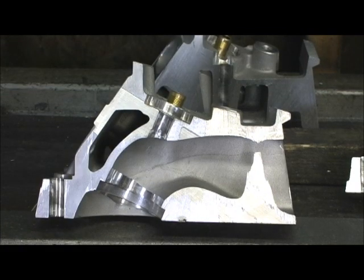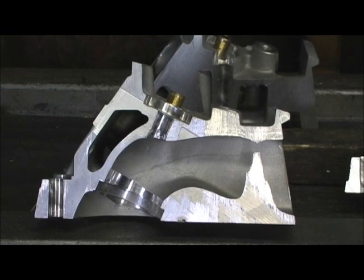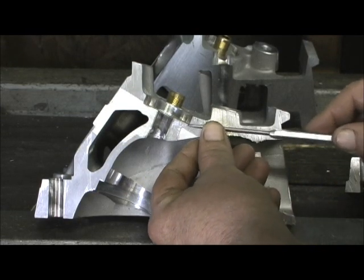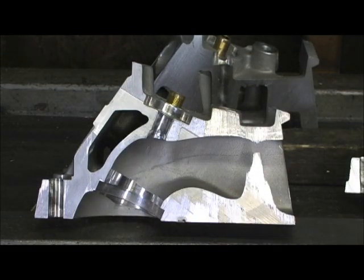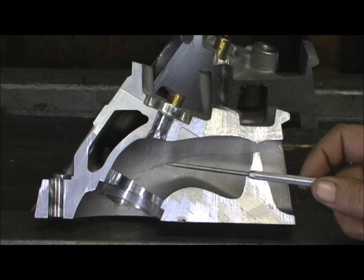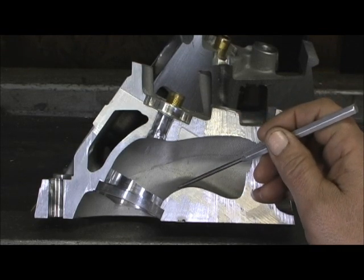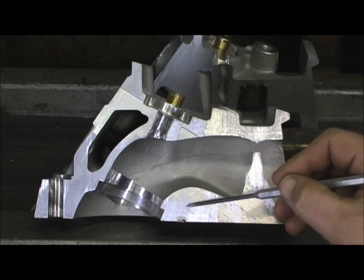Here's what I wanted to point out to you. If I was going to hit this thing seven ways from Sunday, typically what I do when I'm in there with my sonic checker is I try to line up off of this here, because one of the main pinch points of the head beside the pushrod bulge is this area right here — from here to here, and digging back. It is solid cast.